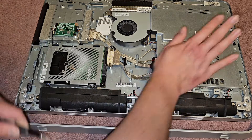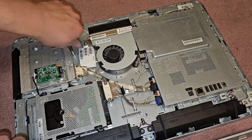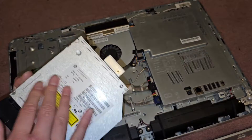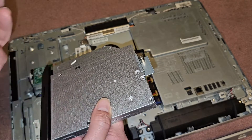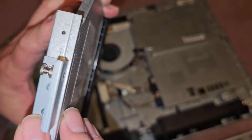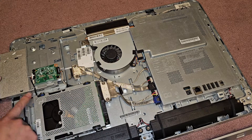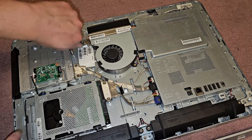You've got two speakers here. We're going to take this metal plate off so you can see what's underneath. There's the CD optical disk drive — one screw, and then you can pull that out; it's spring loaded. If you want, you can also get a hard drive adapter to put a 2.5-inch SATA hard drive or SSD in here. You will have to transfer this bracket over; there are two screws, probably PH1.